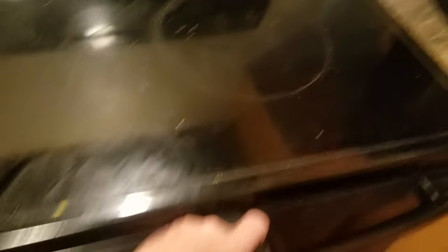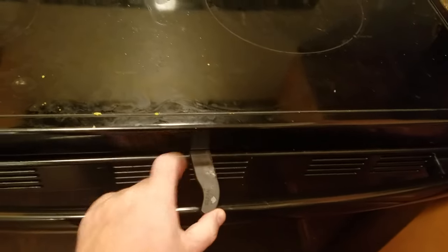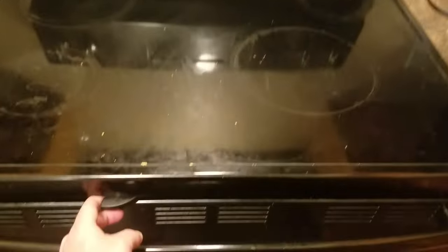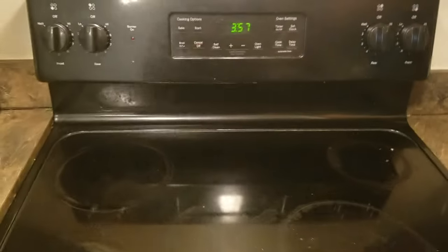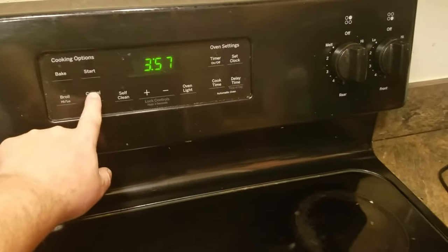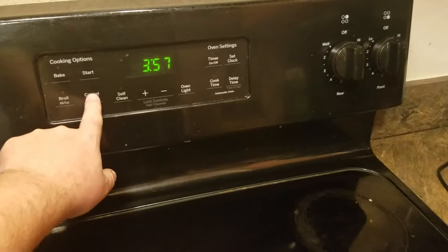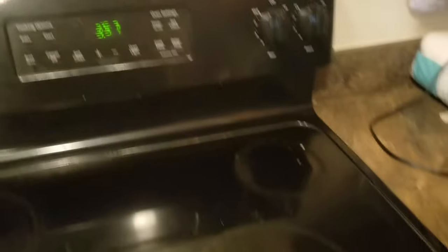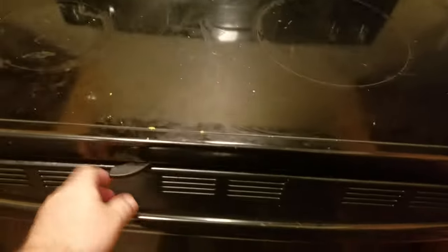As you can see, it's locked. Now all of a sudden I realized it opens — that's because I let it cool down for two hours. For whatever reason if that does not work, on the majority of GE stove ranges you want to hold down the cancel button for about three to five seconds, and that might release the lock after you've already done the full cooling.